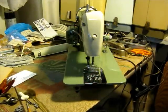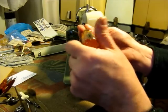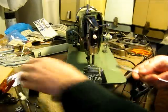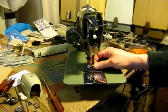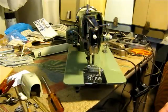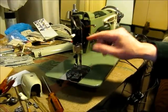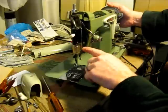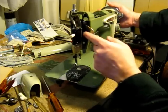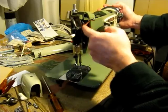Okay, now we'll pull off the single screw over here. I've already pulled the foot and the needle clamp off, so those are just missing right now. We have little pieces of fuzz in there, but behind the light socket is the needle bar right out at the edge. That has a couple of oil areas on it, and then this whole linkage has some links and pivot points, so each one of those pivot points needs to have a drop of oil put on them.